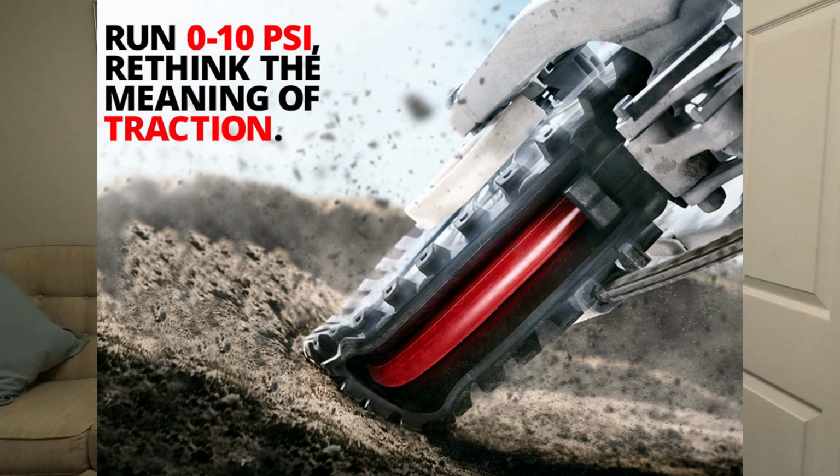They seem to have so much fun going up impossibly steep slopes where you ordinarily would not get any traction because you can't run your tires at low enough pressure. And they're running them at 0, 1, and 2 psi. I wouldn't be that extreme, but it's something I've always wanted to try, to be a little more confident in the slippery, slimy stuff, the serious grades, and have that traction. So I decided to spring for that tubeless system.